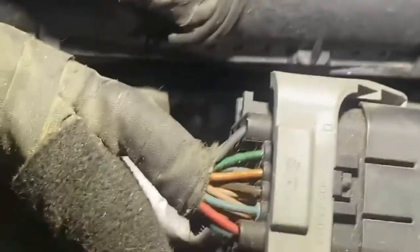If you're using a regular wrench or a short ratcheting wrench to get this right side and you can't reach down there with a long wrench, you're going to want to slide this bracket out some to give yourself space for the ECU and TCU. There's a nut down there between the bracket and the strut tower, and then this bolt right here - that's going to let you slide this out and get some access in there. Once you've got those two bolts tight, tighten your brake lines up nice and snug. They're flared so they don't need any sealer or anything - do not use it, please.